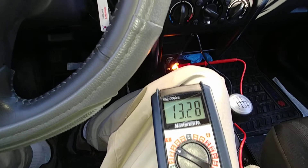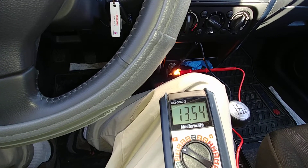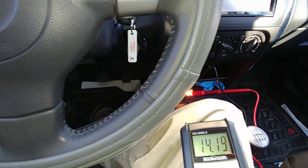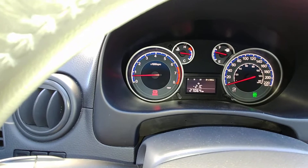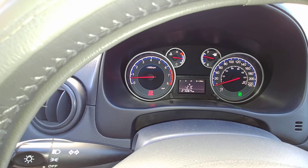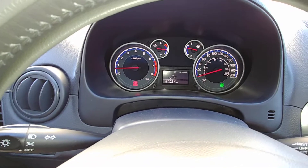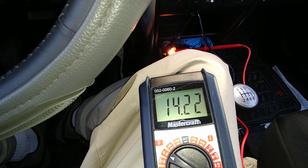I think that was the cooling fan that came on — and I think the cooling fan just turned off. We are slowly down, and take a look at that — we are back down to about 600 RPM. I think what's happening is the battery is now fully charged, and that's why it dropped down to the usual idle. So no load at all, and that's where we're at.